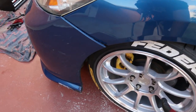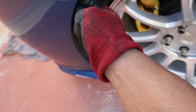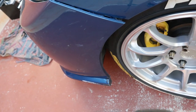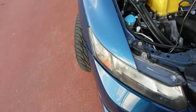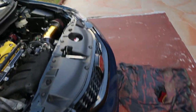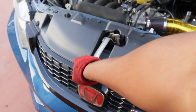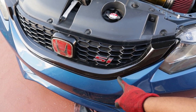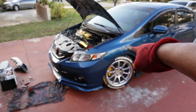So as you guys see, what you do is put your fingers behind the fender liner — all four fingers, get it to your palm, and pull up. Then once you pull up, smack it out like that. Do it to both sides. Now I also forgot about this step — I have to take off the grille pieces too because they're all connected to the bumper. The grille is connected to the bumper, so yeah, take those off and hopefully the bumper will come on out.